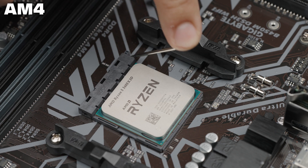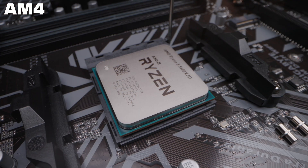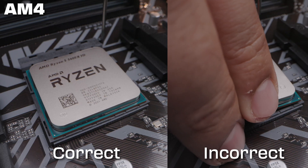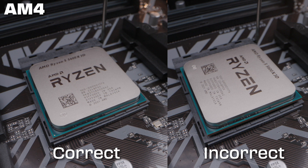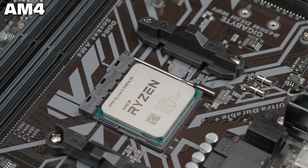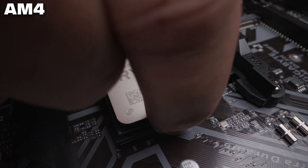Push down on the arm to lock the CPU into the socket, and you're all done. If you feel the pins don't align properly when placing the CPU in the socket, remove the CPU and inspect the pins to make sure they're all perfectly straight with no bends in any of the pin rows. One thing to note is that if the CPU is in the wrong orientation, the pins will not align to the receiving socket and it will not go in. The CPU will only go into the socket in the proper position — you should not have to press down on the CPU for it to go in. If it's oriented properly, it will simply go into place. If you feel it's not going in, check that the CPU is oriented in the right direction.